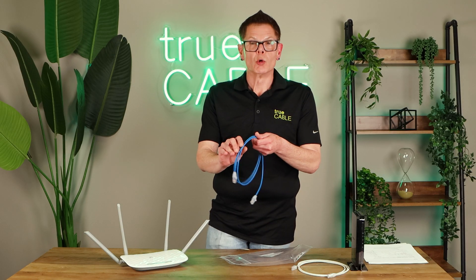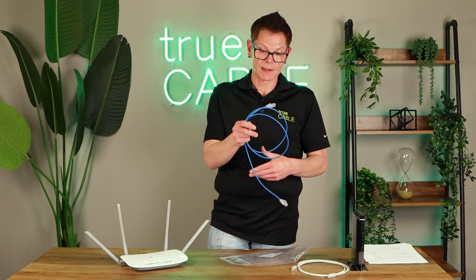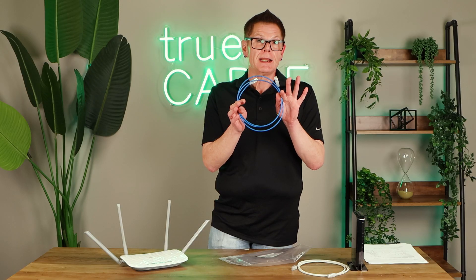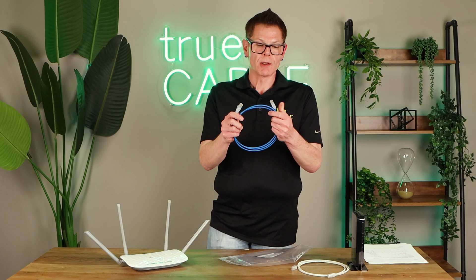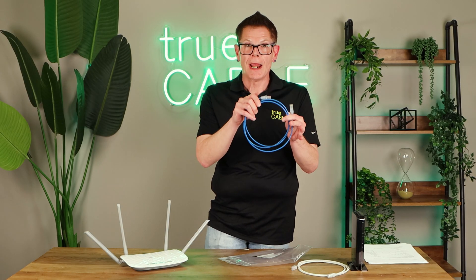As a gamer, you want the best you can get. Ideally, you want a patch cord that passes 100% of the time — one you don't have to worry about. These patch cords are what's known as component-rated. They're certified in the factory, one by one, on a cable certifier that measures actual performance — not just a simple wire map, which tells you really nothing. They're certified against the standard. Our patch cords are also designed so that even at a relatively tight bend at the termination, you don't lose performance, because of the way the connector and boot are designed. Also, these patch cords are thin gauge — 28 gauge — so they're very useful for keeping out of the way and hiding. You don't want a bunch of thick patch cords running all over your place.